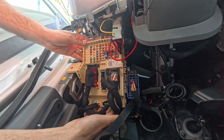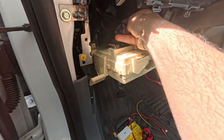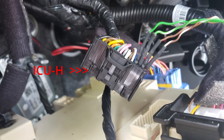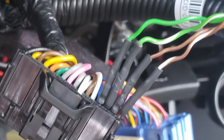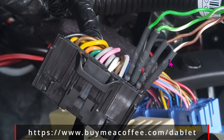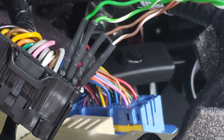To access the ICU-H, you'll need to lift slightly and pull forward — there's not much space to work with. To remove this bundle, just press here and lift away. We need to tap into pins 17 through 20 of the ICU-H. I really don't want to use T-tap connectors because you can certainly damage the factory wiring and there's not much room to work with. Instead, I use the DuPont male connector and just stab it into the back. Any exposed metal contacts will be covered up using heat shrink. If you're looking at it from the front, here are the locations of the pins. Another reason I prefer using DuPont is that if I ever need to remove it, there will never be any trace of modification — in case Hyundai tries to void my warranty.